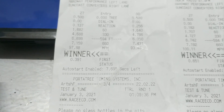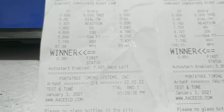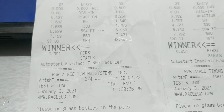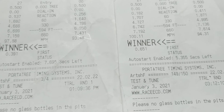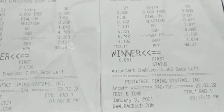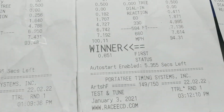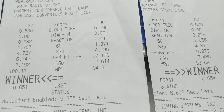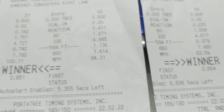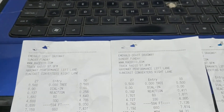Here's what I did. I had car double-zero — my dad's old race car number. First pass was a 1.64 sixty-foot, which is garbage. It should be in the 1.50s — low 1.50s, high 1.40s is what I'd shoot for — and then a 7.43 at 93. Second pass I spun. Third pass was about the same sixty-foot, but I got a 7.46 at 93.5.